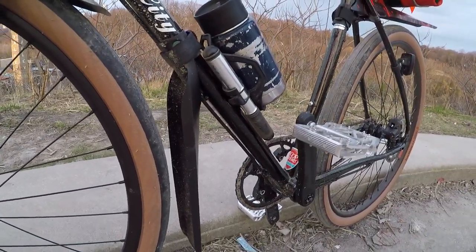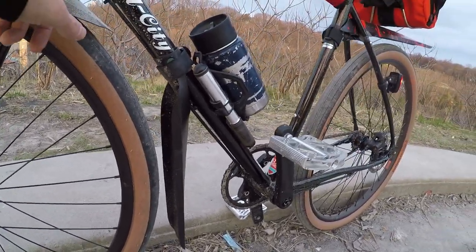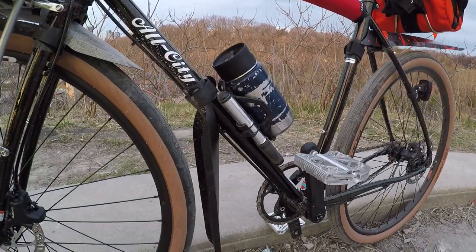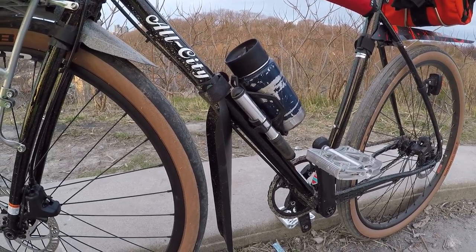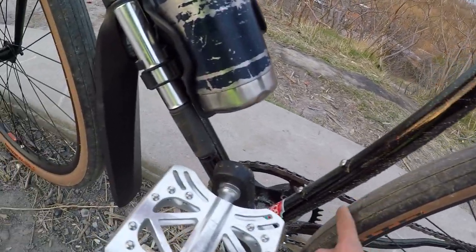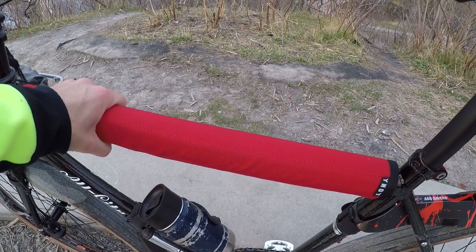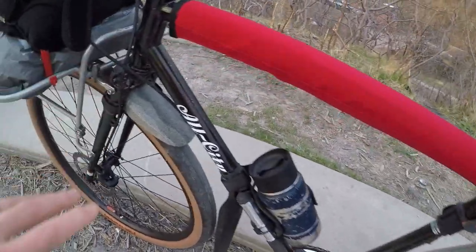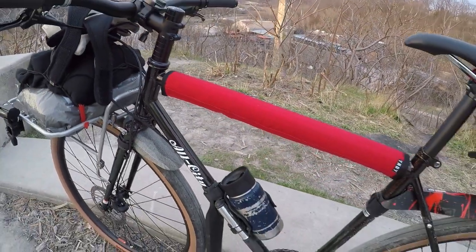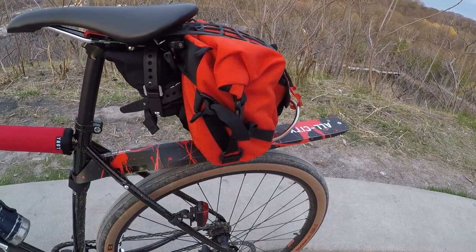I really think that this mid fender — I'll call it — is really interesting. If you do have something like this, be really careful if you have brake cables going down your down tube, because you can pinch them and then it will affect your braking. But overall yeah, I haven't had any issues. This is just dirt. And then the top tube cover — I like this because I carry my bike around a lot. I kind of wanted to get a little bit of color on it. It's got a beautiful sparkly kind of paint job. Too nice for me to be honest. Just trying to get some redness — maybe once this gets a bit dirtier the orange will get darker.